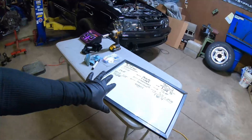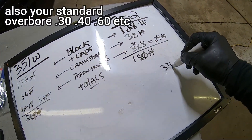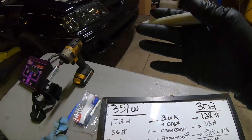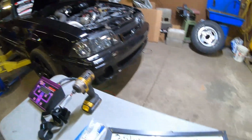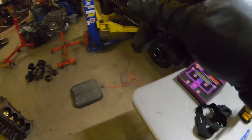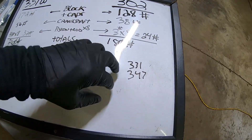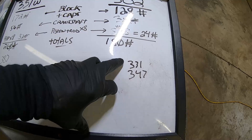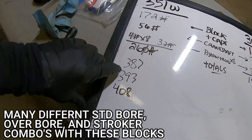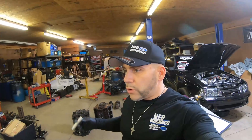The only time I'd suggest considering switching to a 351 Windsor is if you already need a rebuild on your 302 anyway and have the opportunity to swap over. The 302 has stroker combinations like the 331, 347, and in aftermarket form the 363. The 351 has the 387 — which you see built over here on the stand — the 393, and the 408. The 302 also has a stock-bore 327 and 342; the 387 is basically a stock-bore 351, and there's also a 30-over 408 setup. There are a number of great stroker combinations for both blocks.